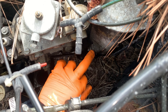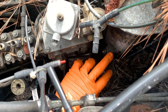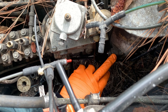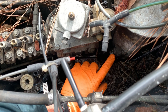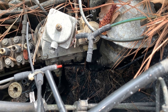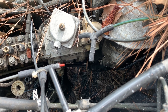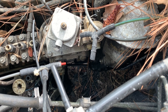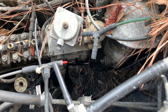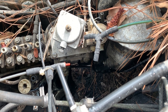These are the same type of fitting that's on the oil cooler line, except these are steel. We can unthread one of these. Since the top fitting on that oil cooler is okay, I'll only do the bottom one — we'll drill it, tap it, and put one of these fittings on it. I've already got the one in my car; it's not leaking or anything, I just don't feel comfortable with it. I haven't driven it because I'm scared those threads will not hold and it'll blow that line off the bottom and I'll lose oil. I don't want to take that chance, so here we are.